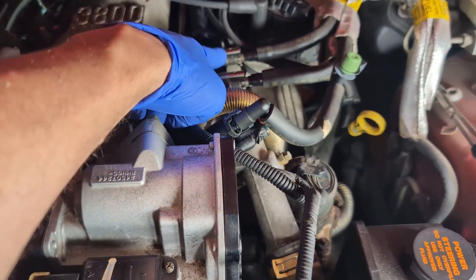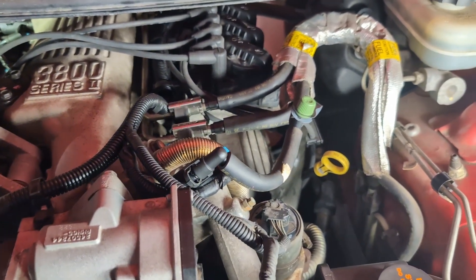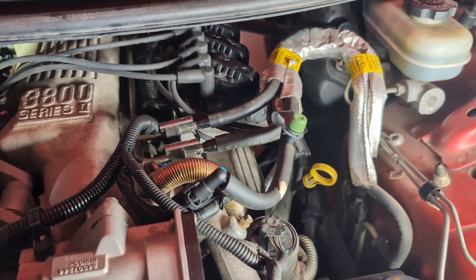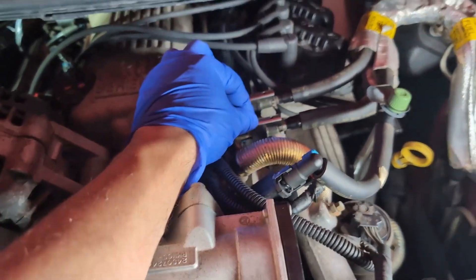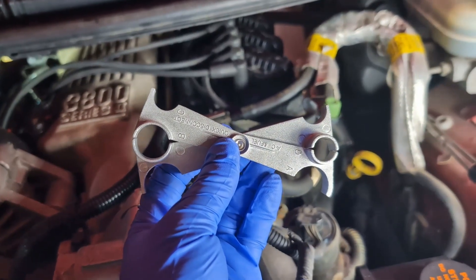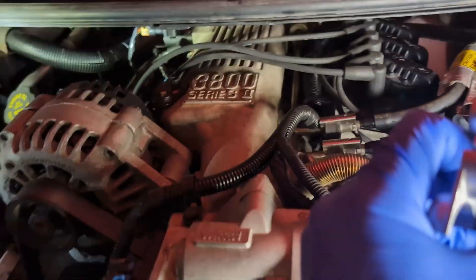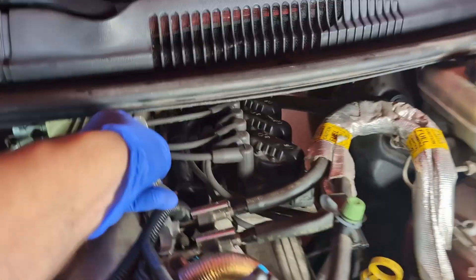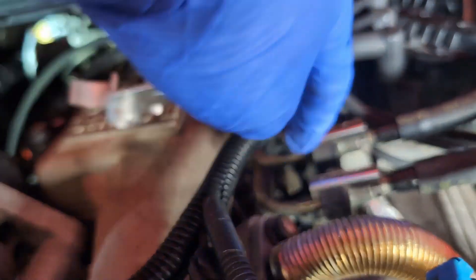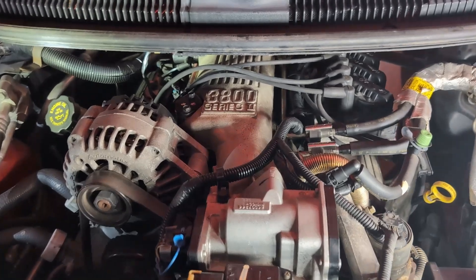Once you've got the coil to the side, you're going to disconnect the fuel rail. First you want to relieve the pressure on the fuel rail or it will shoot fuel everywhere. This is a Schrader valve — pull the green cap off and use a key to press down on the valve and that will bleed off the fuel pressure. There are safety clips; just pop them off. Then you'll need a fuel line disconnect tool — a three-eighths inch size. Put it around the fuel rail, push in on it to depress the springs, and the fuel line just pops off. Do it on both sides.